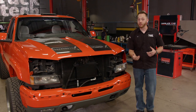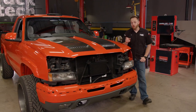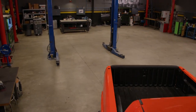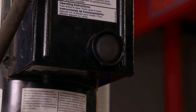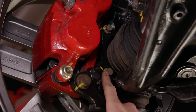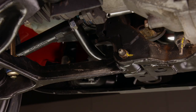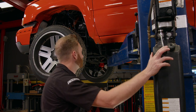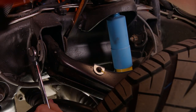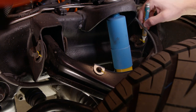I've got about 100 miles on this truck since we put in the new transmission, and I just got the front end aligned. Everything actually seems to drive pretty straight and smooth, but I don't want any surprises, so I'm going to show you guys what we usually do for a final nut and bolt inspection of a project of this caliber. I'll get the truck up on the lift for a nut and bolt recheck, specifically focusing on the suspension, braking, and steering systems. I'll start with the brake caliper bolts, as well as the caliper brackets and the bolts that hold the unit bearing into the spindle. Next are the lower and upper ball joint bolts, as well as the lower control arm bolt — basically any fastener that's attached to a moving suspension part. We just had the front end aligned at a local tire shop, so I'm going to double-check the cam bolts to make sure they're tight. It's especially important to mark these for position on this truck because the four-wheel-drive launches we plan on doing can get pretty harsh, so I need to be able to tell at a glance if they get moved.